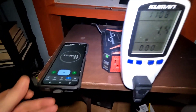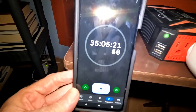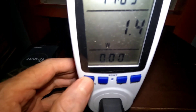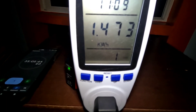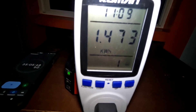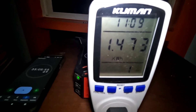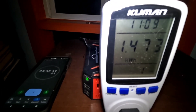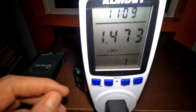Okay, here we are on night two — 35 hours and 5 minutes running off that battery. Right now the refrigerator is not running; it just turned off a minute ago. It's taken 1.47 kilowatt hours — a little bit more than half of the capacity at 35 hours. We'll see how much more quickly it drains that battery on the lower half; sometimes they do drain faster in the second half.